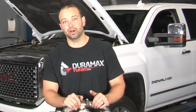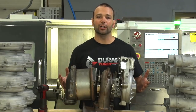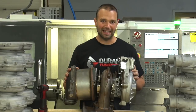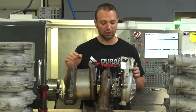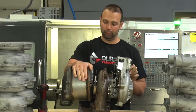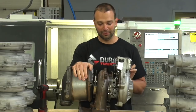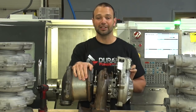I'll take you in the next room and take the L5P turbocharger apart and show you what I'm talking about. At the heart of the L5P's ability to make power reliably and to keep heat down — aftermarket guys need to know about this turbocharger. This is the newest one on the block, a Borg-Warner unit, big cat on the back, big new servo actuator. I think this is the biggest turbocharger I've seen on a Duramax.